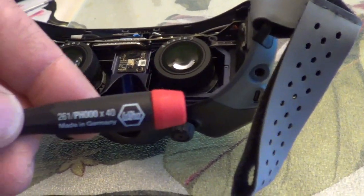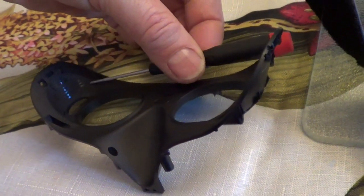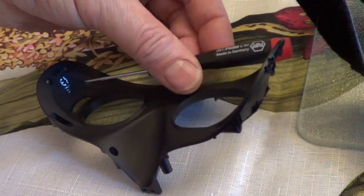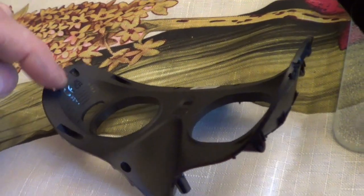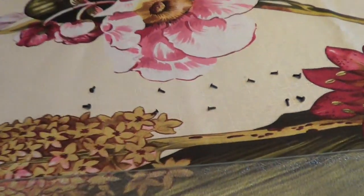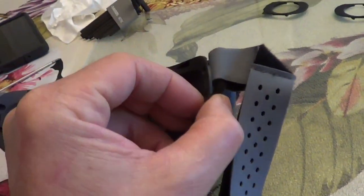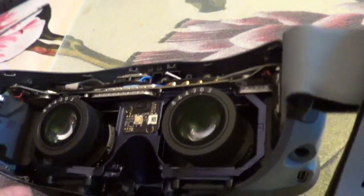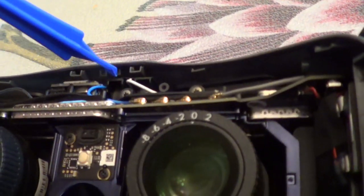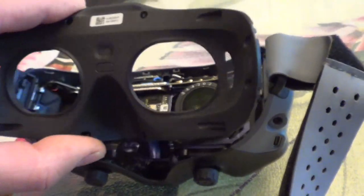To pull off the back plate you have to use a good Phillips screwdriver — it has to be good quality. There are some side screws; keep the screwdriver down low because they're pretty easy to strip. There are six screws times two, so twelve screws total. To remove the back plate, first pop out the sides, then use a lever tool because there's a little catch, and once you pop out the top the whole back plate comes off pretty easily.